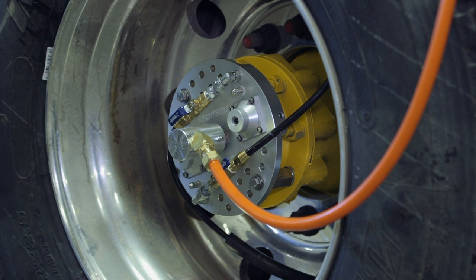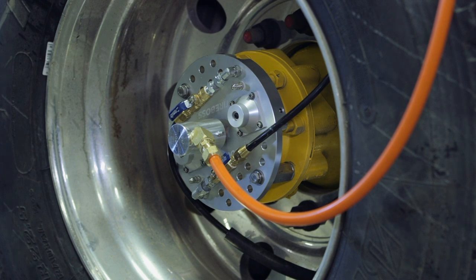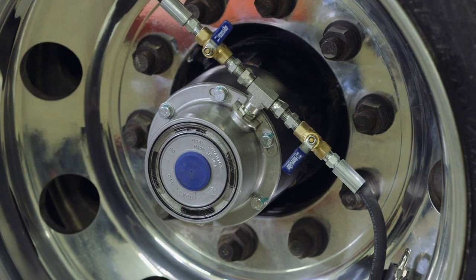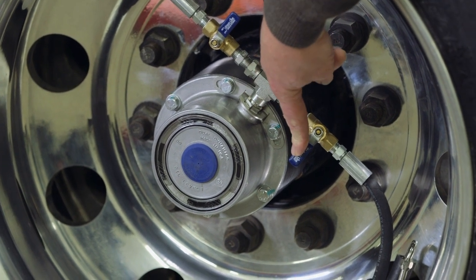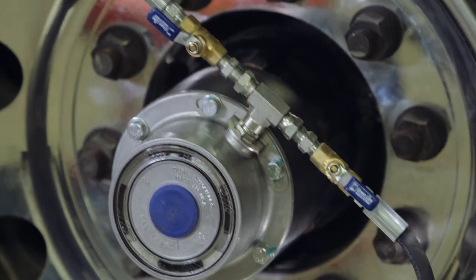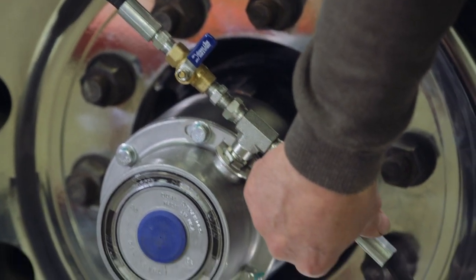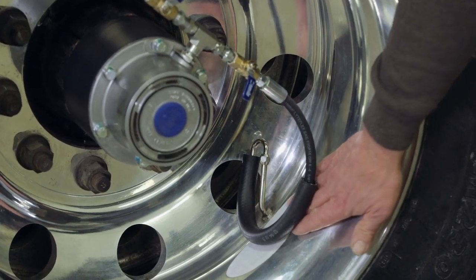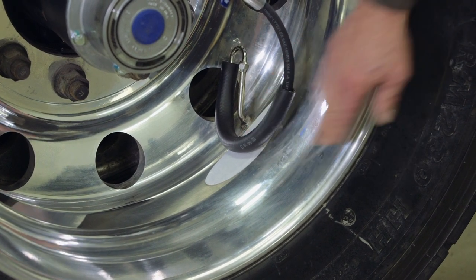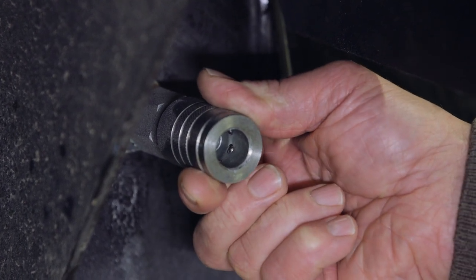Remember that you must be at your maximum tire pressure setting when chains are installed, to ensure the side walls cannot touch each other with the chains in between the wheels. For a trailer wheel without automatic wheel end valves, it has manual valves which should always be open for normal operation. For long periods of parking, close these wheel valves. On installation, Teflon pads are placed where hoses touch the rim to protect against abrasion to the aluminum rim. This is a typical connection for the TireBoss system supplying the trailer from the tractor unit.